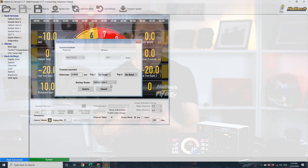For our workshop customers, you might want to set up one of the trip meters as a service interval that can't be reset with a button, as a reminder for the customer to bring the vehicle back to the workshop for an oil change, or a checkup, or for any other reason at a predefined distance. The other trip meter is resettable on a button for measuring things like fuel consumption, or as a trip meter or whatever. The choice is yours.